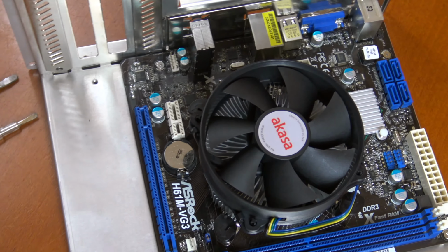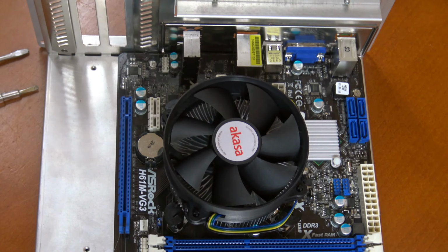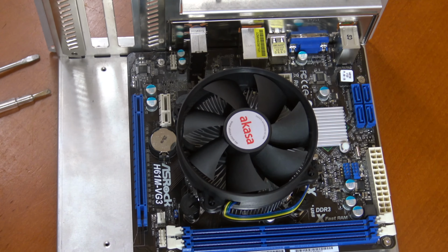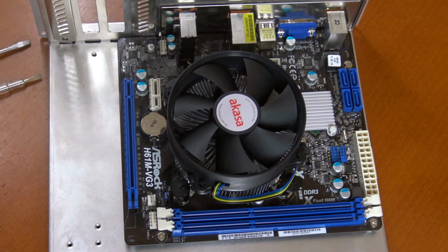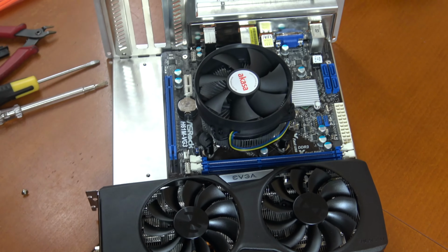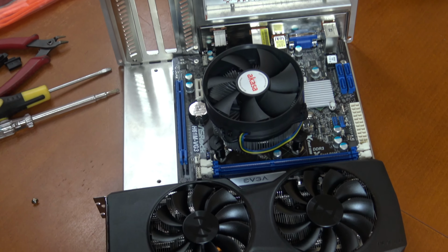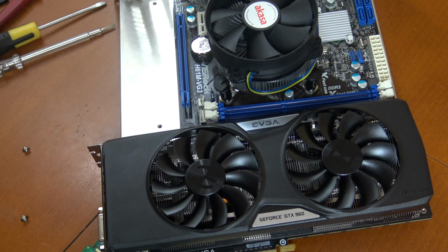When I got home and started to do some tests, it was quickly obvious what the problem with the motherboard was. There was a little bit of conductive thermal paste on the CPU socket. This time I got lucky and was able to clean it, but most of the time if there is a problem with the CPU socket, the motherboard is probably lost. But that's not the point.